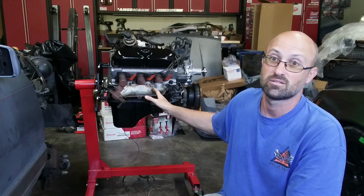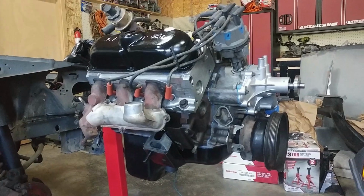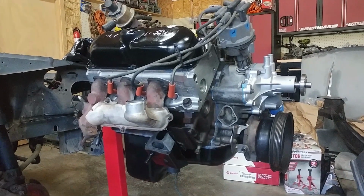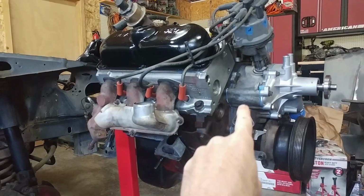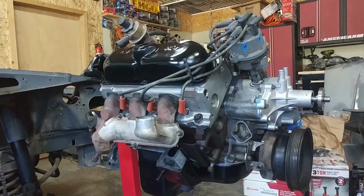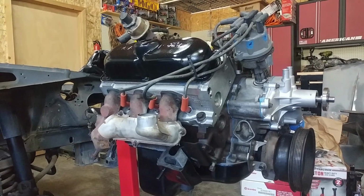So now you can see I've repainted the valve covers and the oil pan. Those were scrubbed down completely, degreased, and then hit with some primer and paint. Everything else was aluminum, so you've got steel, which is this piece, the timing cover. That was scrubbed down as best I could get. The aluminum heads shined up nicely. Those are basically 3-cylinder aluminum heads for this V6.